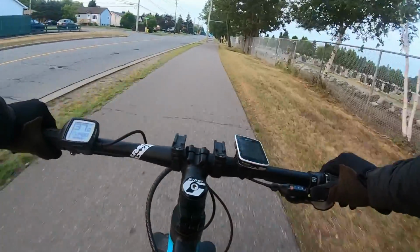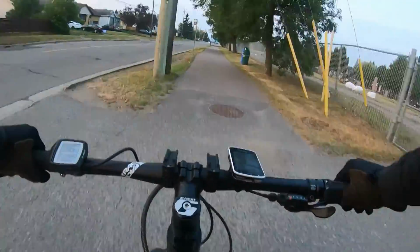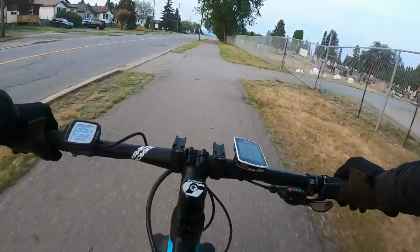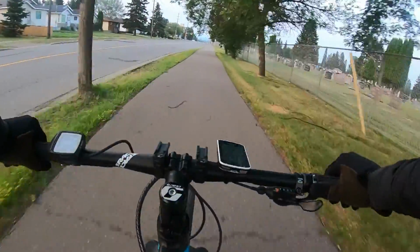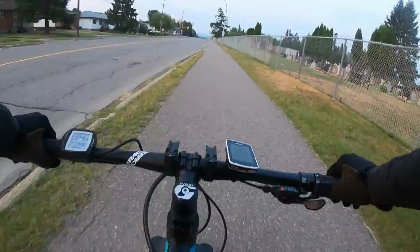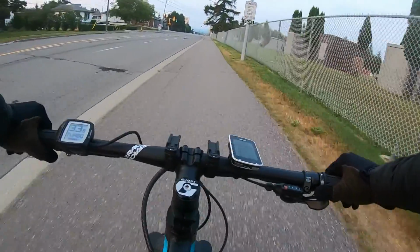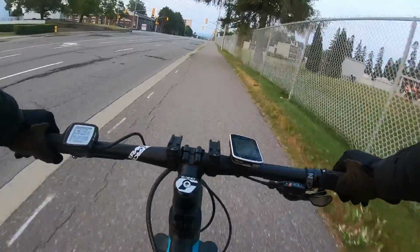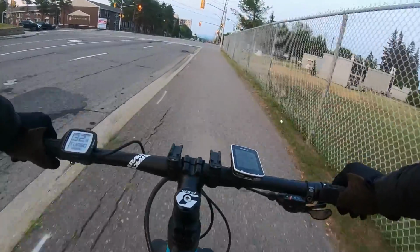So they both have their good points and bad points, but I would say if you want an electric bike that feels the most like a regular bike, the mid-drive gives the most normal bike experience. And maybe I'm saying that because this is so low powered at 250 watts. I know Bafang is starting to offer some high wattage mid-drives, but all the Boschs are like 250.